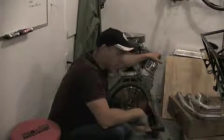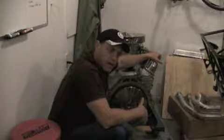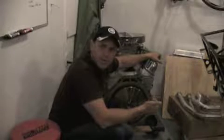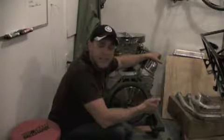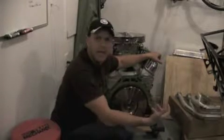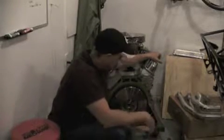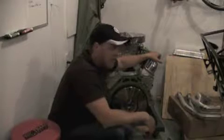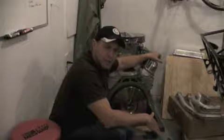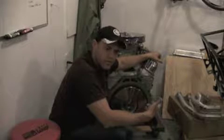If you read online, people who hook up QuickTime bell housings and find that their starter either fails to engage fully, or if it does engage sometimes stays in the engaged position — they have starter problems and can't quite figure out why. Well, that's the problem. This issue has been around on and off. Some people don't have it, some people do. I've found through research it's usually the small block Fords that have it.